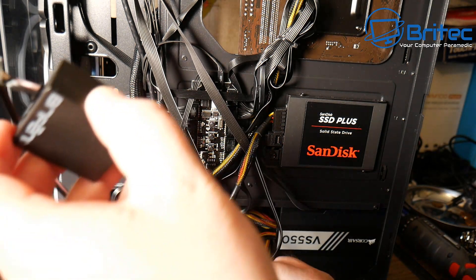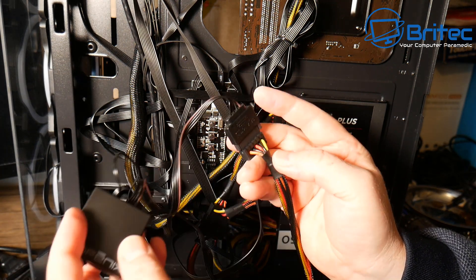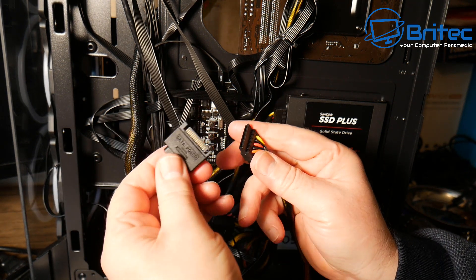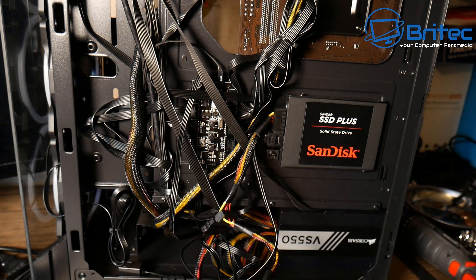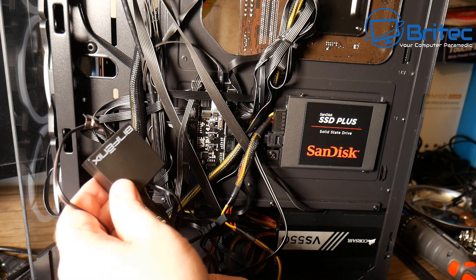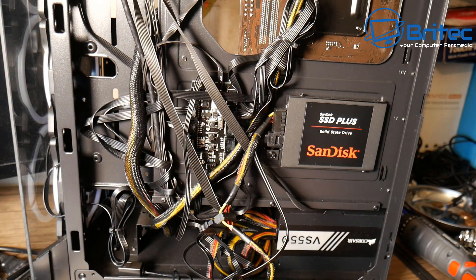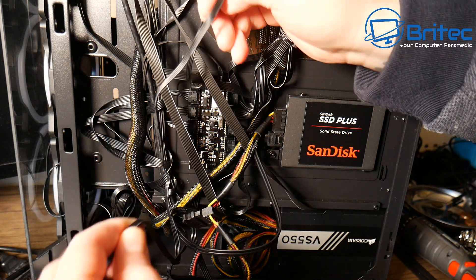You can control it via the mode control, the button on the case, or the remote. It runs off SATA power as well. Now, you may be thinking this route is a complete pain — and that would be correct. I wouldn't advise anyone to go down this route because it'd be cheaper to just buy a motherboard that supports addressable RGB. But if you've got the parts lying around and want to get out of a tight jam, this is what you can do.